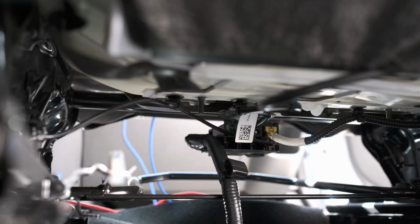From what I've gathered online, it's a smart idea to go ahead and disconnect the battery power. There's the airbag sensor that's built in or wired in. If your power is connected, it's not that you're necessarily gonna trigger the airbag, but you might trigger an error code that you're either gonna need an OBD2 tool or have to go into a dealer to get that code removed. If you look at Far Out Ride, they don't mention doing it, but I am just gonna play it safe. If you have any questions, let me know in the comments. Well, let's see how this goes.